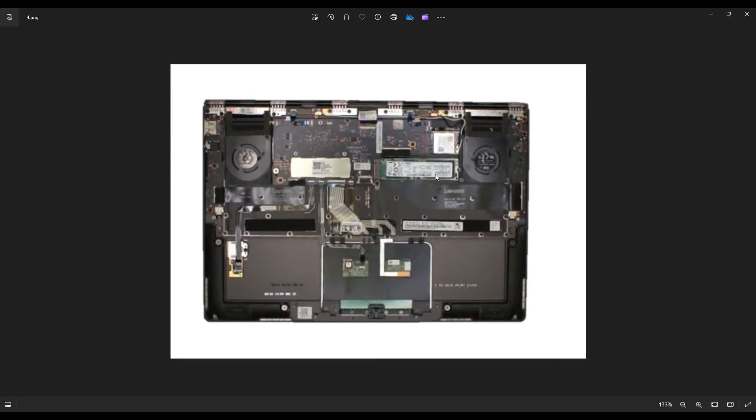The next item is right here — your solid state drive and your Wi-Fi card. They're both held in kind of the same way. There's one screw on the right center of each board. Once you unscrew that, your solid state drive will unplug from the port on the left. Same thing with your Wi-Fi card — you remove that single screw, pop up the antenna wires, which just snap right up, and then it will slide out of the left port.